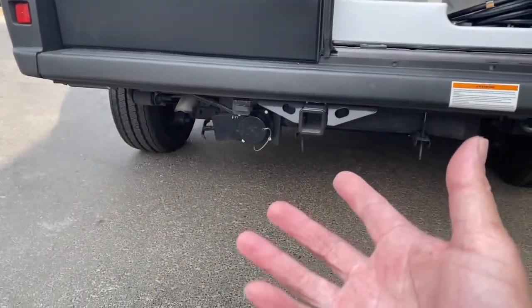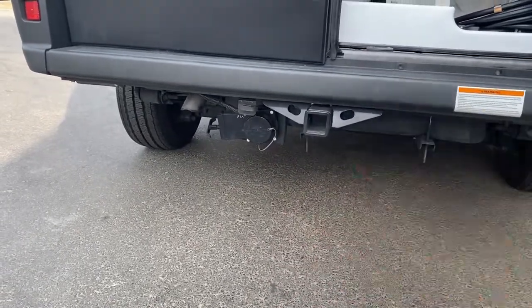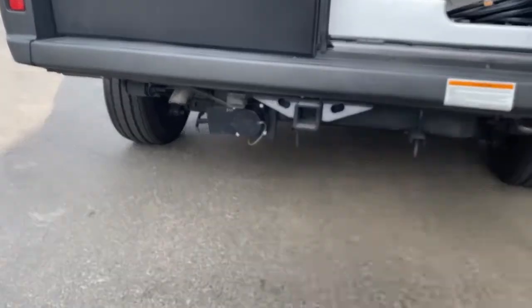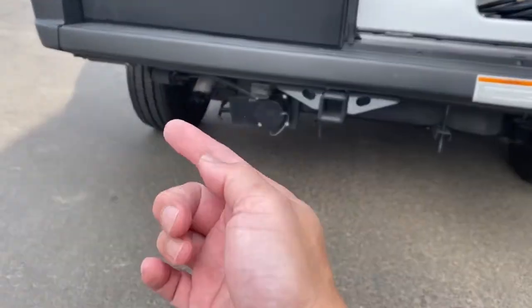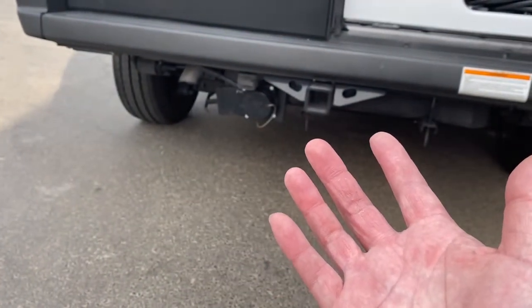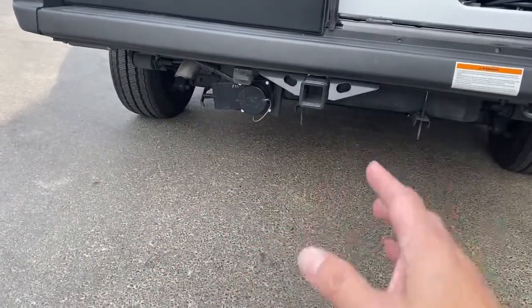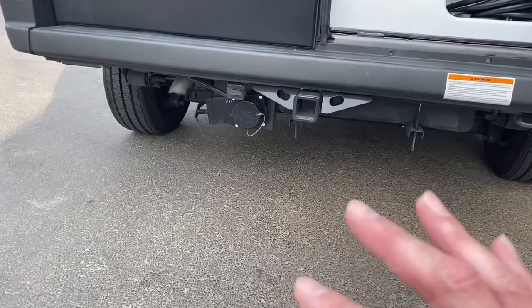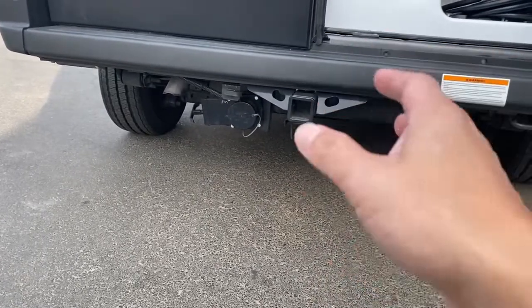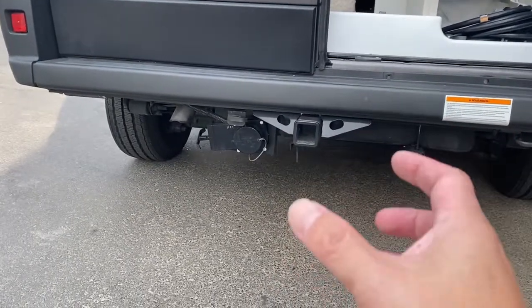It's dirty soap and water — not black tank waste, just dish soap. Unplug it; it'll leak a little but not drain completely. Make sure you're in a place that can accept gray water, then pull the handle out. It'll trickle, then burst with a lot of water, then start trickling again. It'll never fully stop, so after about five minutes of trickling, go ahead and shut the valve, put it back on, and give it a quarter twist — not a full twist like opening a water bottle.